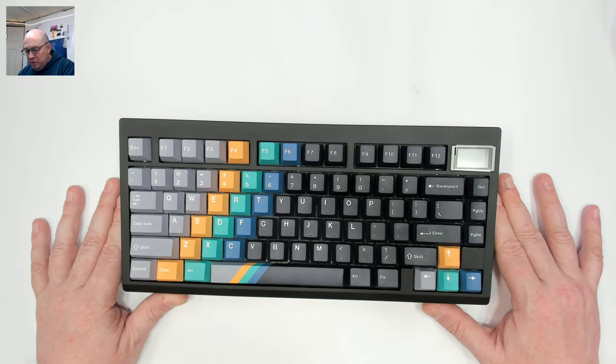There's another issue that people have been reporting with both the GMK87 and, I don't know if it was this one, but I just experienced it myself. I was using it, and all of a sudden, the function keys, like if I hit function F1, it was like Mac, even though I checked, I'm like, no, I'm in Windows mode. And Alt was acting as the Windows key. I don't know what this issue is, but the way that I have found to fix it is just to put it into Mac mode, put it back into Windows mode, and then you're going to have the keys working as you'd expect them to.